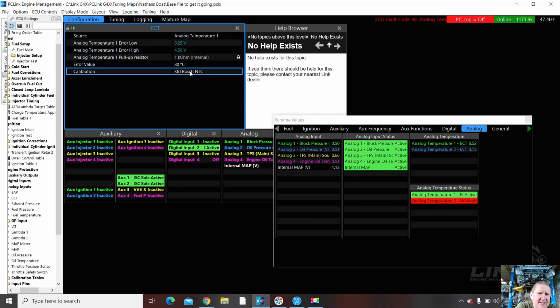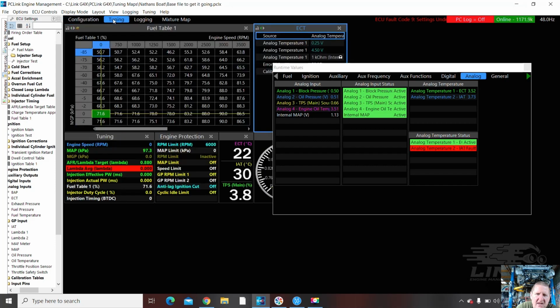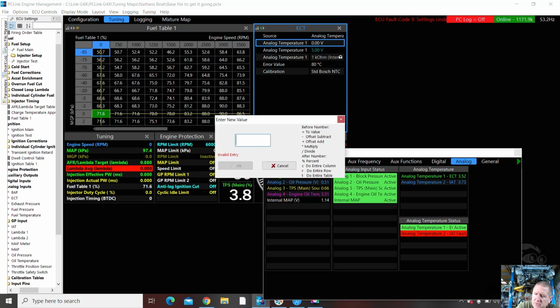1K, 80 degrees, and standard NTC. Now, if we just error value of 80 degrees, if I just pop into here, oh, it's come down to 22 degrees. A moment ago, it was actually showing 80. I think if we go down here, 0 there, 0 there, and you can see it actually brings up an error value because the numbers in that analog temperature were wrong. If I put this as 5, that turns off all fault codes. So you can't have 0, 0, you can have 0, 5, and that turns them off. Turns the check engine light or the fault off. I'm going to go 0.25, oh, not 25, 0.25, and I'm going to go 4.5.